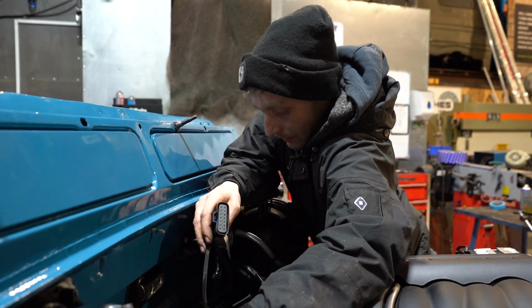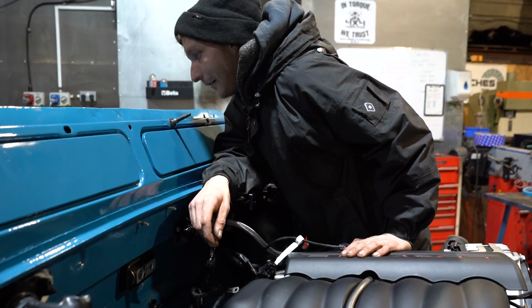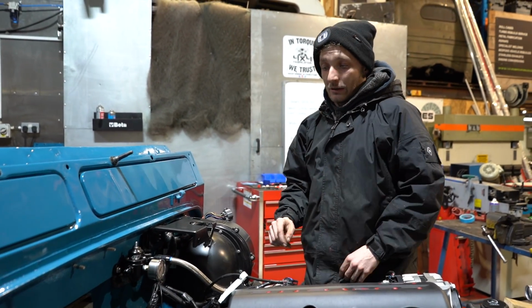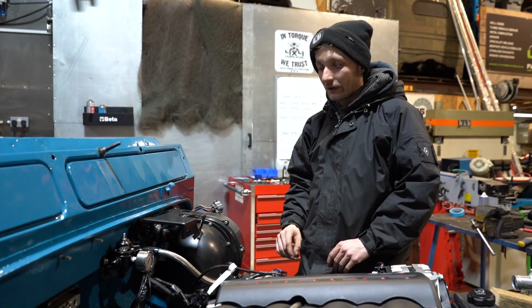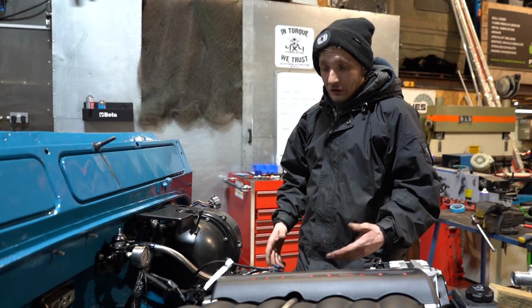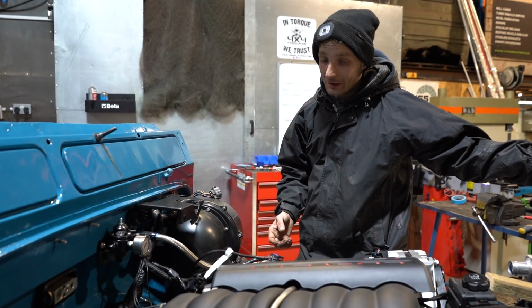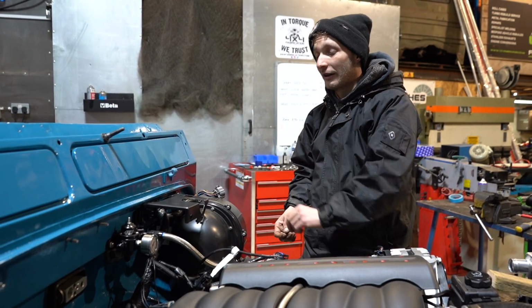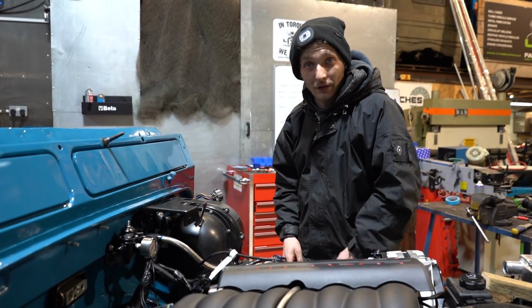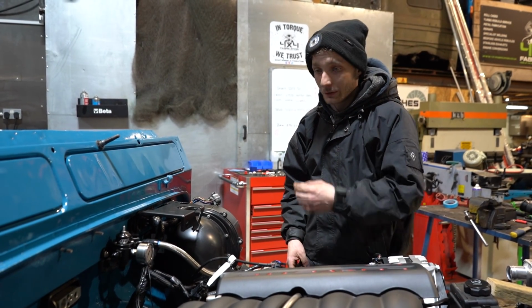So it's very, very much worth putting a hefty amount of time into planning your route, because should you need to find something in the future, be it 6 months down the line or a week down the line, when you come to turn the key, you need to know where it is, where the wires that you need or the group of wires that you need to test or to use to diagnose.